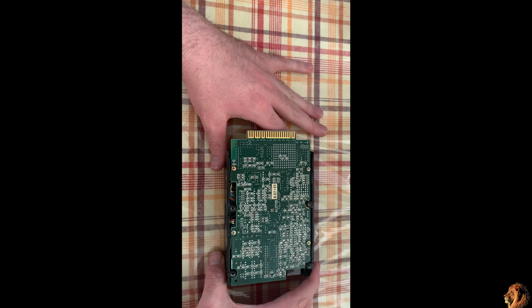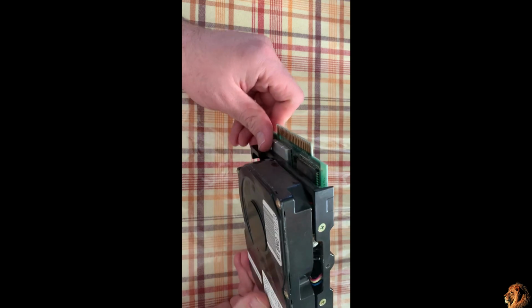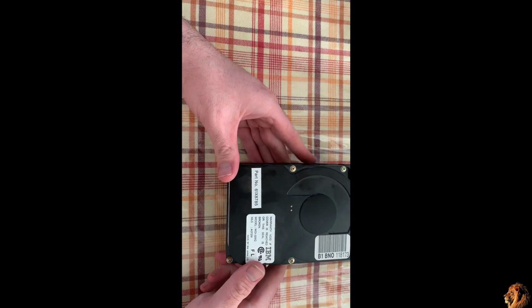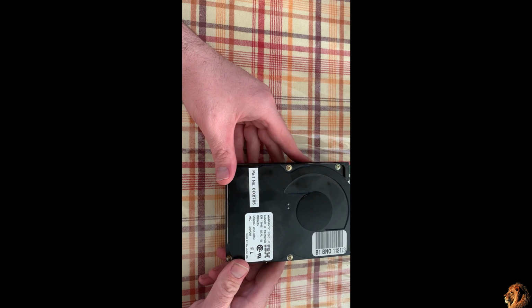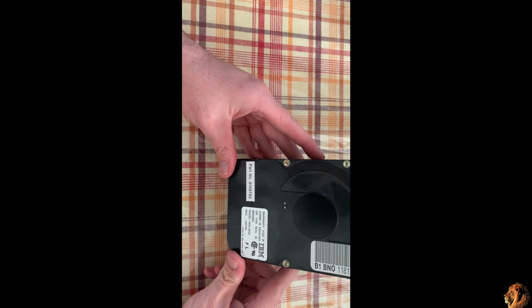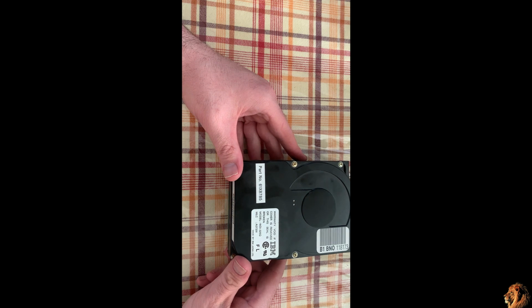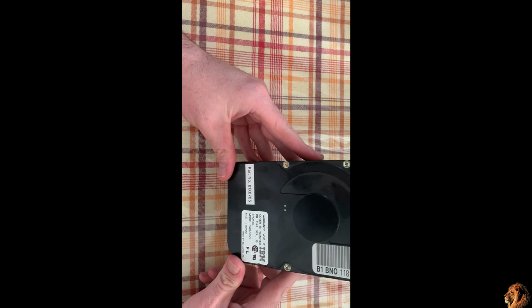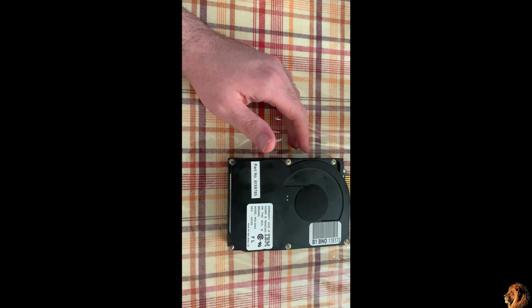We have another Unwrapped, Unscripted, where we're actually going to be unwrapping the innards of an IBM hard drive. This one came out of an IBM PS2 Model 25. Screams like a banshee when you power it on. It will do a successful, unconditional, low-level format, but fails everything else. Fails seek, fails ECC, fails conditional format, fails high-level format, and I'm not sure if that's normal or not.